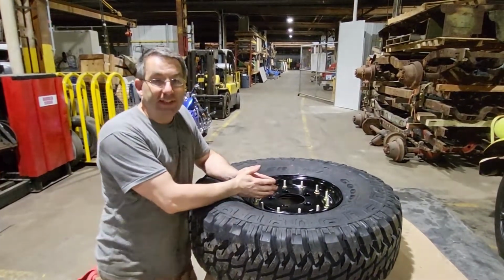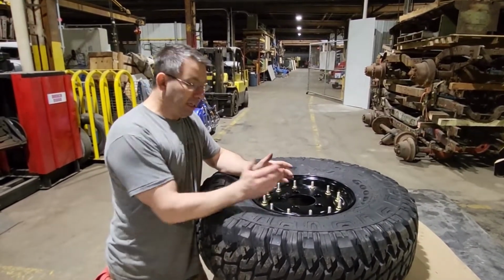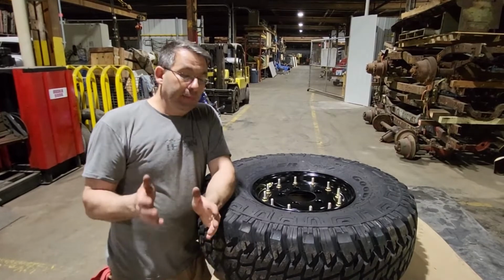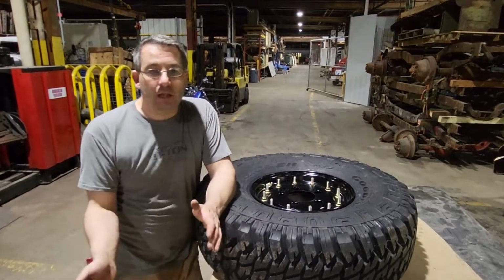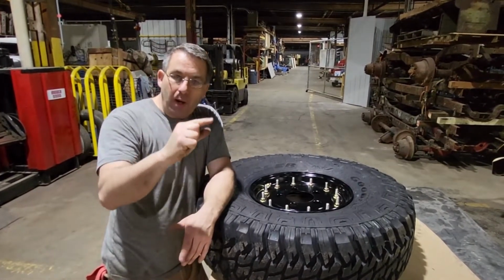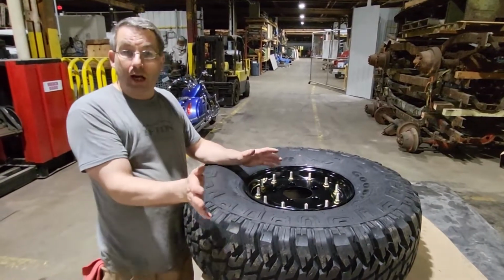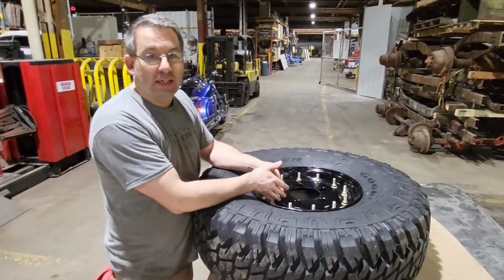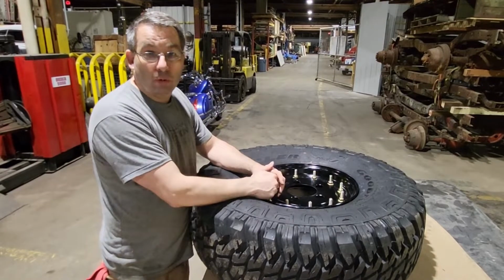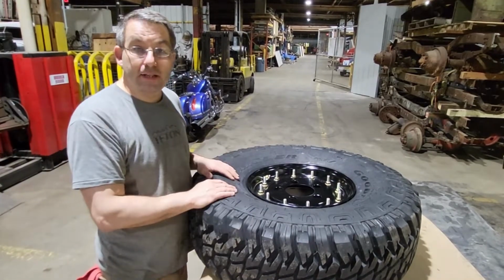These nuts are what we call a deformed lock nut. So there's really not a torque spec per se, because if you were to look at the nut closely, the hole where the threads are isn't actually round, it's oval. And what they do during the manufacturing process is they make the nut just like they normally would, but then they put it into a press that grabs two of the flats and compresses it ever so slightly. That way you don't need the nylon insert, so a nylock you might call it. Because of the deformation in this nut, it actually holds on to that stud at the same torque spec all the way through. So when I install them with the impact, I run it down until you get that right tone, and that's it, they're done.